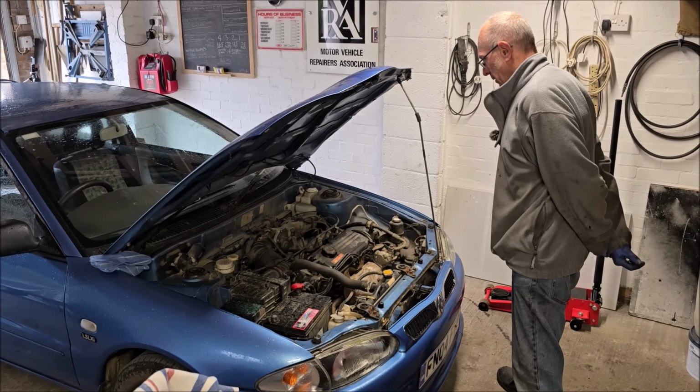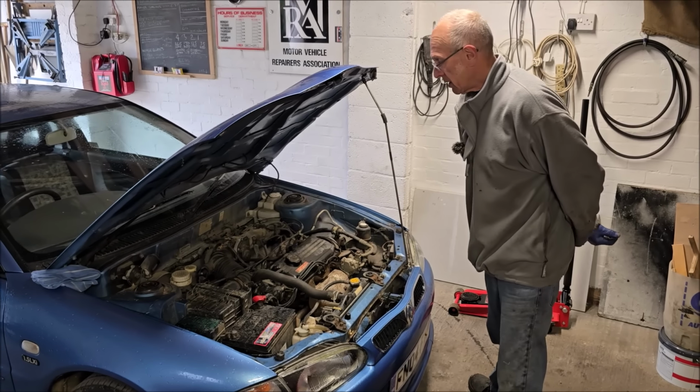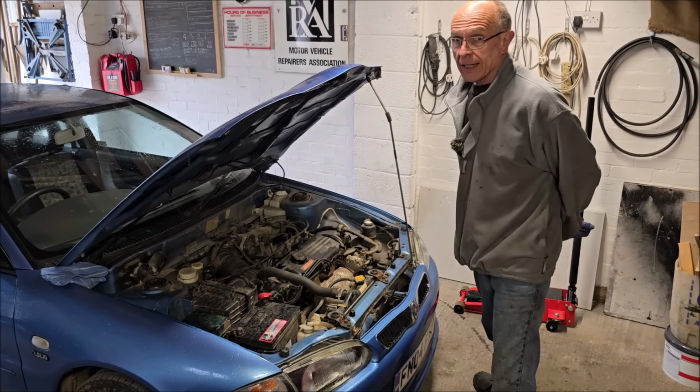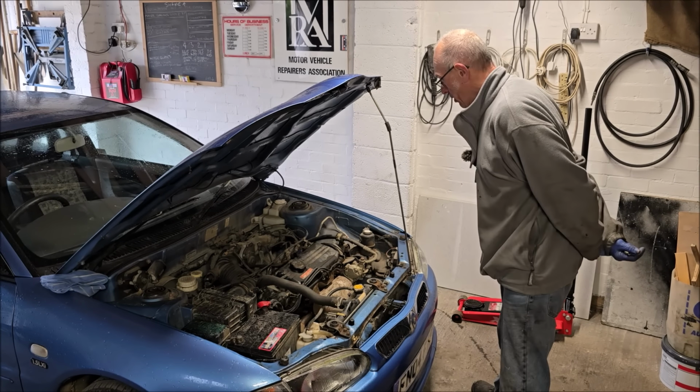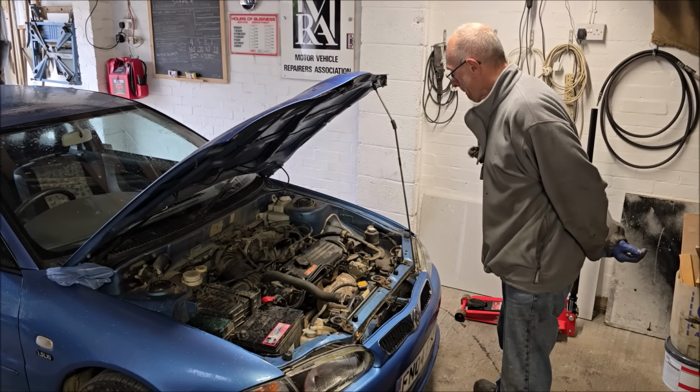So basically we haven't fixed the misfire. We're pointing towards an injector now, aren't we? We're looking towards fueling. I'll tell you what I'd do next if it was me: move the injector from one cylinder to another, see if the fault moves. There you are, that's what's coming in the next video then.